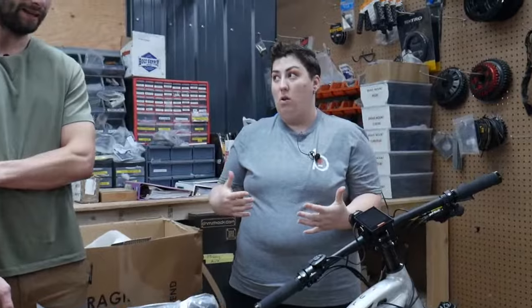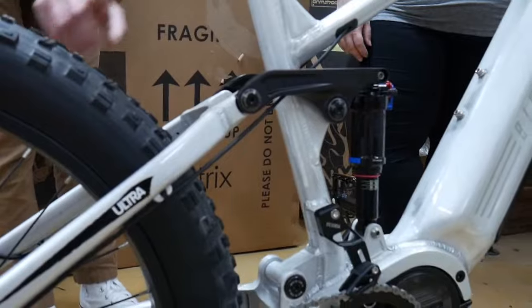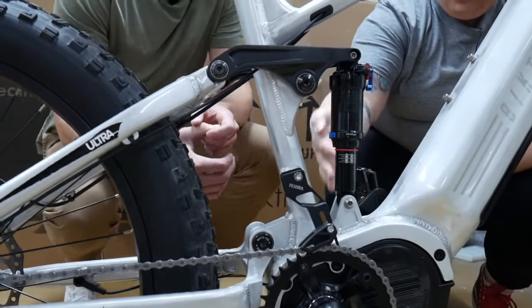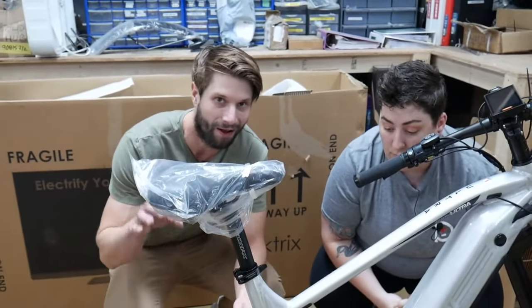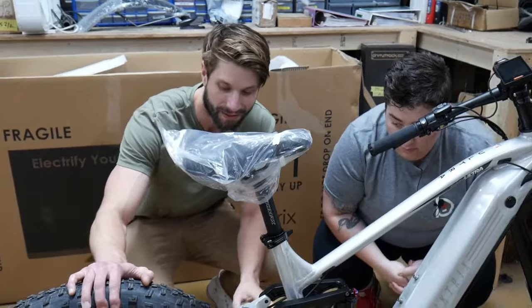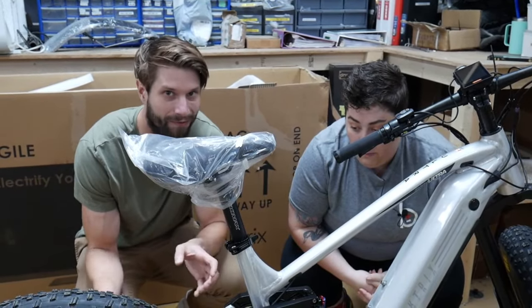This is the Ultra FS Pro — FS stands for full suspension. A full suspension bike has not only suspension on the front with the fork, but also a pivoting section in the back to add suspension in the rear. The mid suspension shock allows your rear wheel to move over rough terrain and keep the wheel on the ground. While a lot of people look for full suspension for extra comfort, it's really great for keeping the wheel solid to the ground on very rough terrain. The downside is you can't fit a big rack, and you're very limited on how much you can carry.